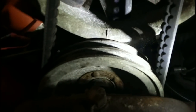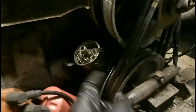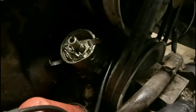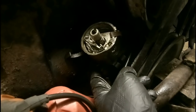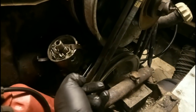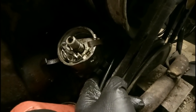It really wants to spark probably about there. So I need to turn the distributor, but the distributor won't turn. There's a bolt just down there - I can free that off and it still doesn't want to turn, so I'm going to have to deploy further violence I think. Let's get all my timing lamp gear out of the way and see if we can free that thing off. I seem to have damaged the distributor, but I haven't managed to move it one millimetre - it's absolutely seized in place. The adjuster bolt is out completely, so in theory the distributor should spin. It doesn't want to spin and it doesn't want to come out.